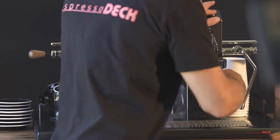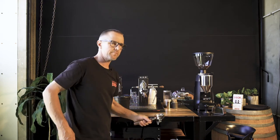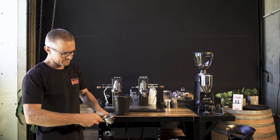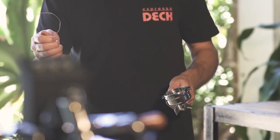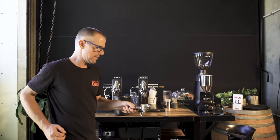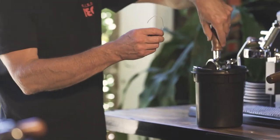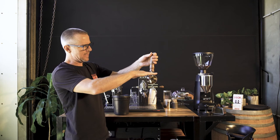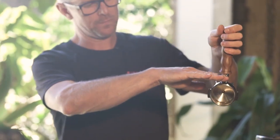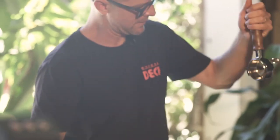As for cleaning the coffee machine, it's very important to clean the group portafilters. To do that, I remove the filter basket. There's also a spring that holds that filter basket in — if you do lose that, the filter basket will easily fall out into the knock tube. I do like to remove it carefully for cleaning purposes. We're going to place that into the bucket. When filling the bucket, don't fill past the bottom of the handle — particularly a timber one, but any handle shouldn't get wet at all.